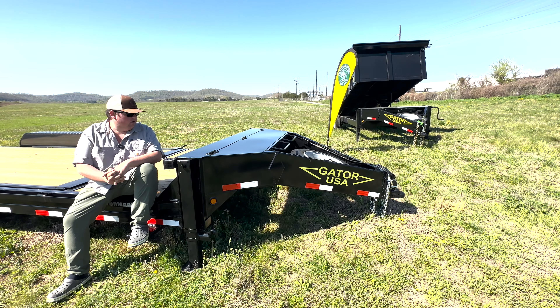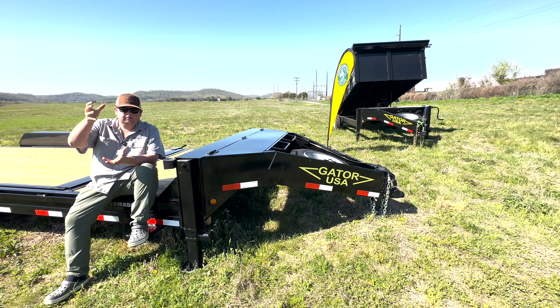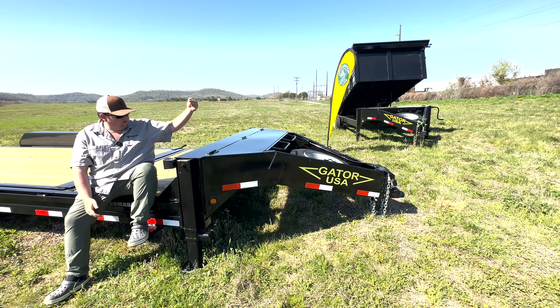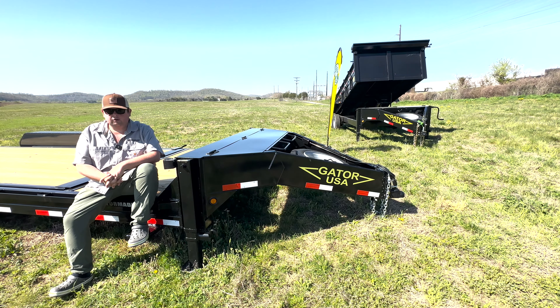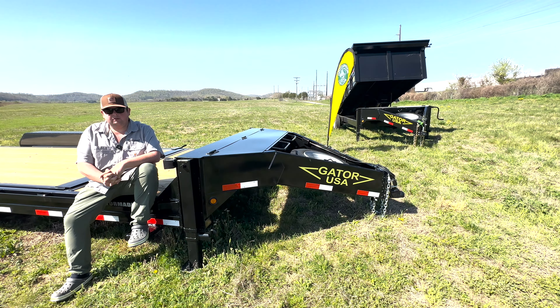You get an adjustable coupler at the front. If you've seen a lot of adjustable couplers, they hang out from the top and bottom — there's just a sleeve there for that to slide on. On this trailer, it's flush with the entire frame, so no matter where you hook your adjustable coupler, you don't lose any structural advantage. If you use the highest or lowest notch on a lot of adjustable couplers, that's where it's weakened and it can break. On the Aardvark, you can use your adjustable coupler the way it's meant to and not have to worry about losing any structural advantage.